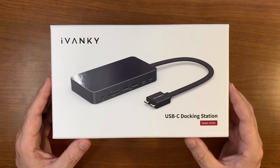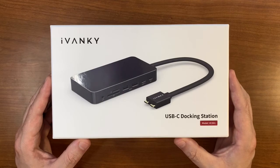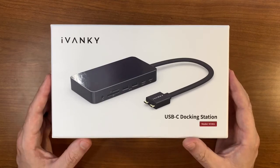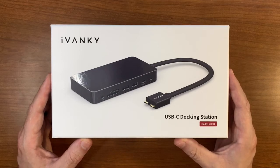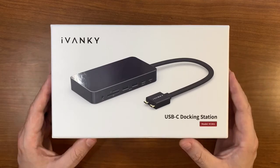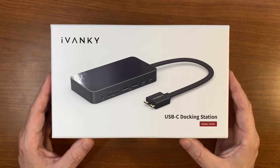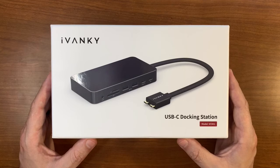The way they achieved this, knowing the limitations of multi-stream support in macOS, is actually by using two USB-C ports on the side of the MacBook Pro. One interesting caveat is that Windows in a Boot Camp environment does support multi-stream — so it's not necessarily a hardware limitation for macOS, it's actually more of a software limitation. Everything I've read online says that Apple continues to advertise DisplayPort 1.2, which is supposed to include and implement MST, but they don't seem to care. The only way to use a Mac with multiple external monitors over a single docking station is to boot up into Windows with Boot Camp.